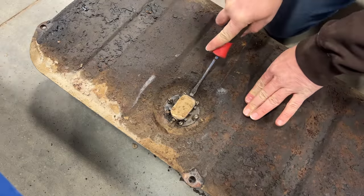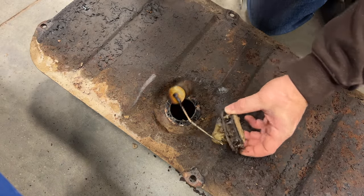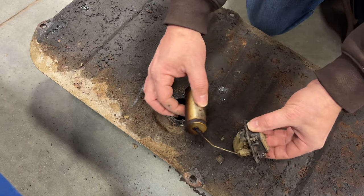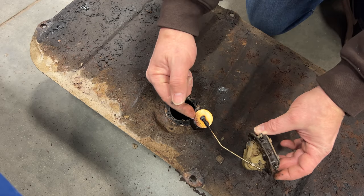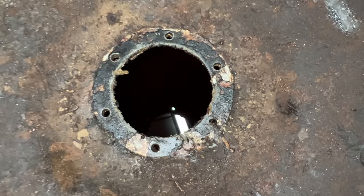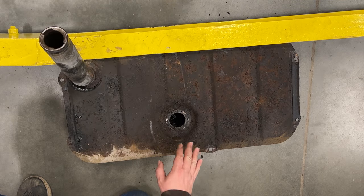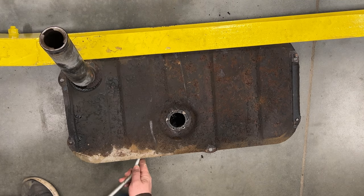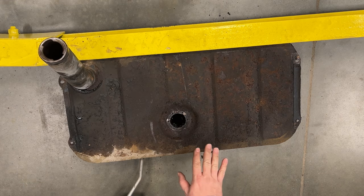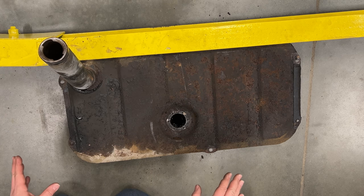Let's see how bad this is. The fuel sender is frozen up from sitting — it will no longer move. I'm surprised it isn't really rusty. You can see the fuel level where it had sat over the years. From what you can see right now, it doesn't look terrible down in there. I'll have to get it drained and flushed to see the real condition. With the fuel drained out, it doesn't look the best, and if I try to blow air through the outlet it seems like it's completely clogged up. So I'm just going to throw this tank away — these are available, so it's not worth cleaning this one up.